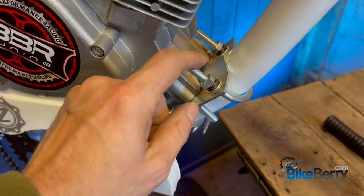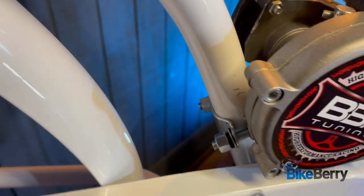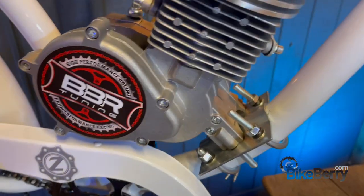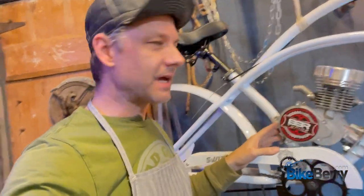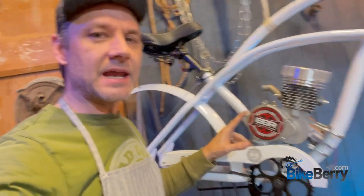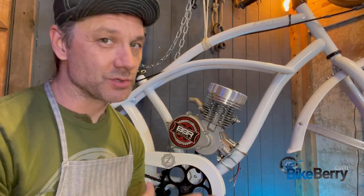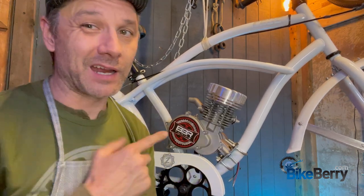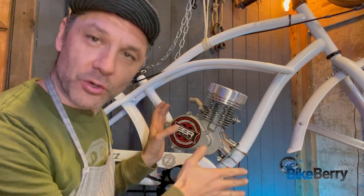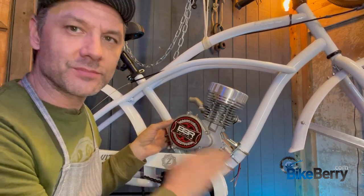I'm sure you've noticed that I haven't doubled up the nuts, added lock nuts, or really changed any of the hardware — just using the stuff that came with the engine. The reason is, as you set everything up and go to the next steps of installing your rear wheel, chain tensioner, and chain, I may have to move some of this stuff. So I'm not going to add any of the reinforcements until I'm satisfied the position of everything is exactly where it needs to go. That's really, really important. The Swiss cruise bike is made perfect for the spacing of these engines — this was a lot easier than it was on my Schwinn frame. So I highly recommend getting this over that. The focus was just getting it mounted and getting proper positioning. We'll go in later and add all the lock nuts and beef all that stuff up.